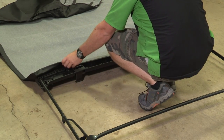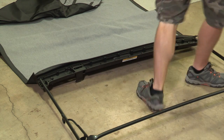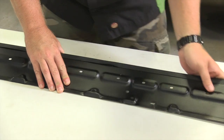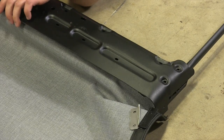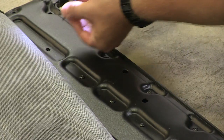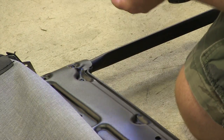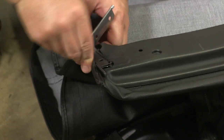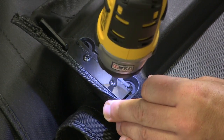Next, begin installing the fabric to the frame. Start by laying the soft top fabric with the backing side up. Align the notch in the fabric with the notch in the header and secure it in place with a few strips of tape — the tape will not be seen once installation is complete, it simply keeps the material in position. Place the edge protector on the front edge of the upper header and secure it with the pre-applied double sided tape. Lay the upper header on top of the lower header, sandwiching the fabric in between. Starting with the center hole, install 23 No. 8 by 1.5 inch high-low screws to secure the upper header. Secure the upper header to each side bow in the outermost holes using four No. 8 by 1.5 inch pan head washer screws. Then flip the soft top material back over the entire support bow frame, fold the header back, and slip the fabric pocket over the header. Secure with two No. 8 by 1.5 inch high-low screws through the fabric and metal flag on both sides.